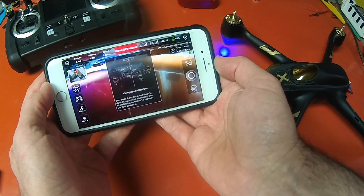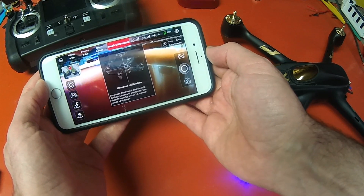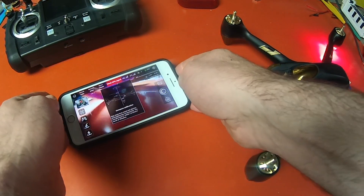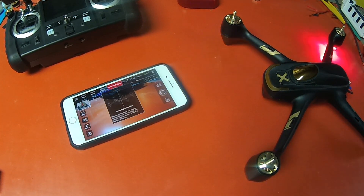So that's all there is to it. If you have the new compass and wanted to know how to initiate the compass calibration yourself, that's how you do it. The only other way to initiate it is if you crash, so you don't want to do that. From time to time it may ask you for a compass calibration, and usually that's if you've had it upside down, bumped it, or set it down real hard. It is a little bit sensitive on some models, so don't be alarmed if it asks you occasionally for a compass calibration. Just do your calibration and you should be good.